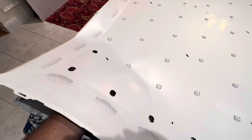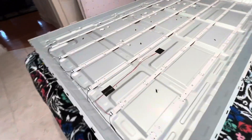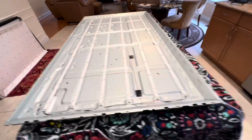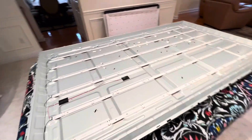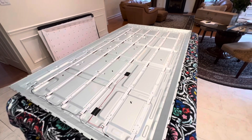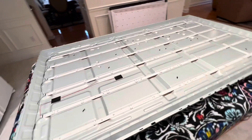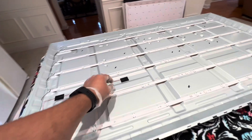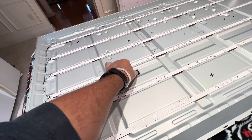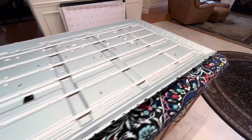Now we have access to all our LED lights. They only illuminate two colors — white and blue. White is used a lot more than blue, so over time the white LEDs burn out and that's why you get a blue screen. I have a box here which I'm about to open — I hope it's the correct lights for my TV. Here is only one strip going back to the motherboard in the back.